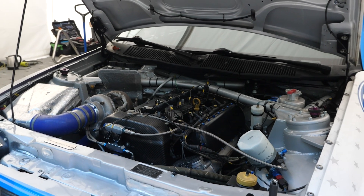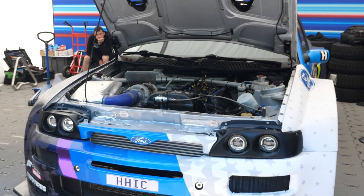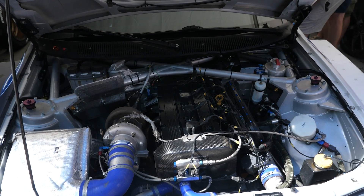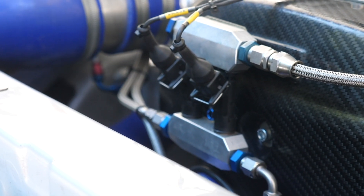In this case, the injectors used are a compressed natural gas injector, so this means that they're quite comfortable moving compressed air and they're also a relatively high flow. They're also very good, because they are a fuel injector, at being controlled precisely, which of course helps with our boost control.